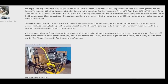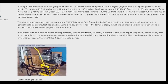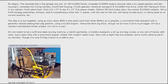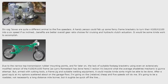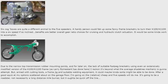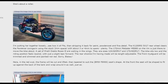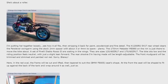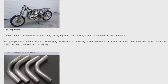Now let's talk engine swaps. Already mentioned you can swap a 16-valve 1000cc brick into your 8-valve frame, but you can also swap an 1100cc brick, and even a 1200cc if you really want that 130 horsepower. As with all of them, you still have to swap over the Motronic fuel injection system because Jetronic isn't going to work. The 1100 will need the harness from the donor bike and the running gear ideally, since the running gear for the 1100s and 1200s is stronger.